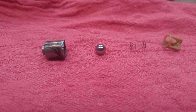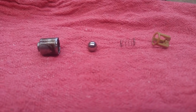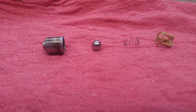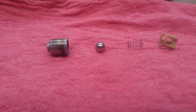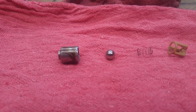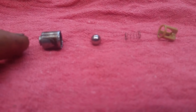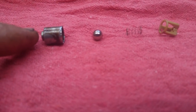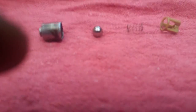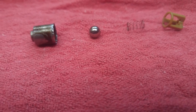This here is an oil check valve. This goes in between the cylinder head and the block on the E36 M42 engine, found in the 92-93 E36 318iS. The purpose of this valve is oil pressure comes in through here from the block, goes past this ball and pushes this ball against this spring, and that spring is located inside that little cage, allowing oil pressure to flow into the cylinder head.